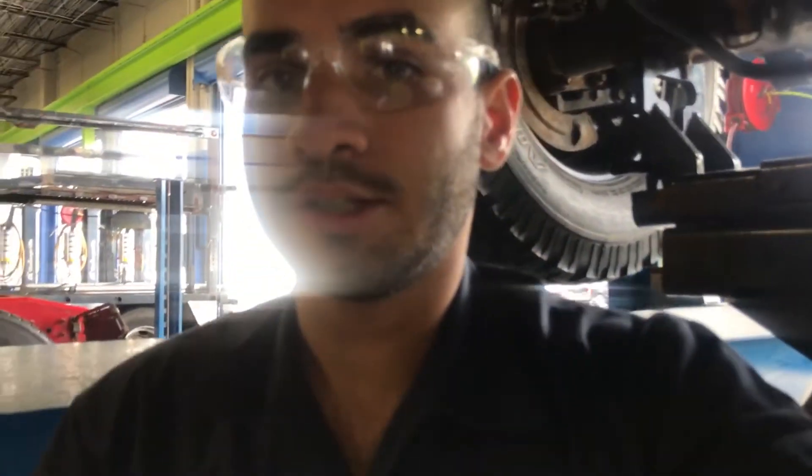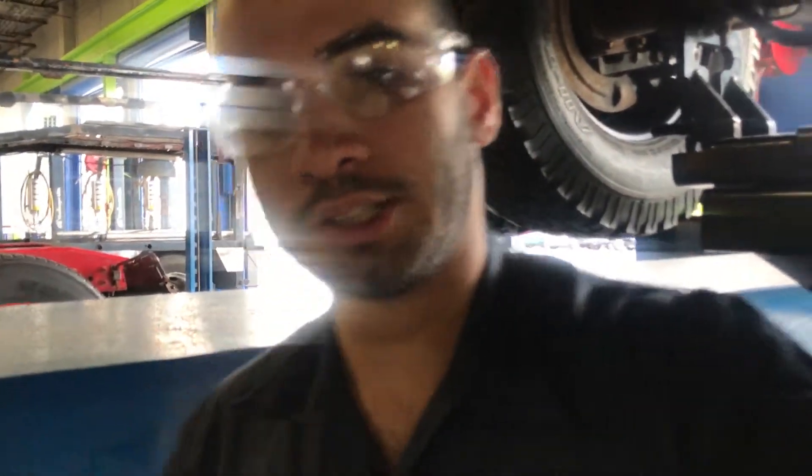With ours being at 2.4 and 2.0, our driveline is 0.4 degrees out of phase, which is under spec — so that's a pretty good degree to be within spec. You'd want to do that with both pieces of the drive shaft. Basically you'll turn your drive shaft around, put your socket and level here and here, and check your phasing. That concludes this portion of phasing. I'm a student at Jones Technical Institute and I study diesel technology. Have a great day.